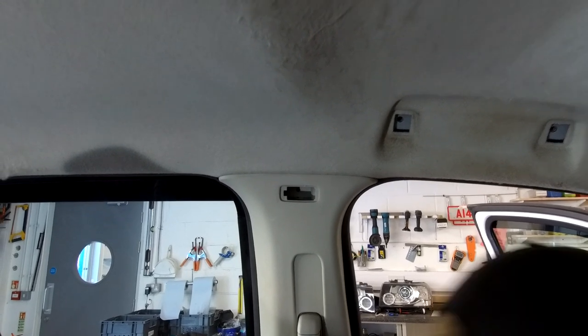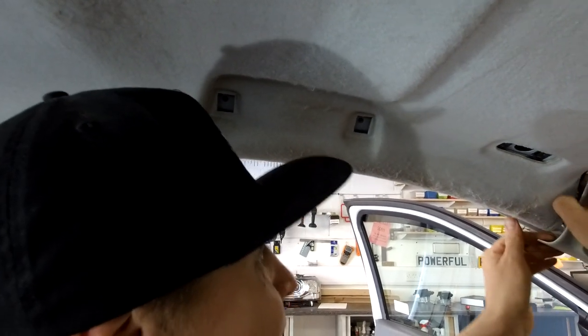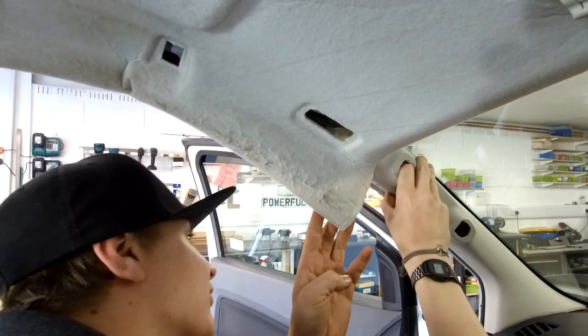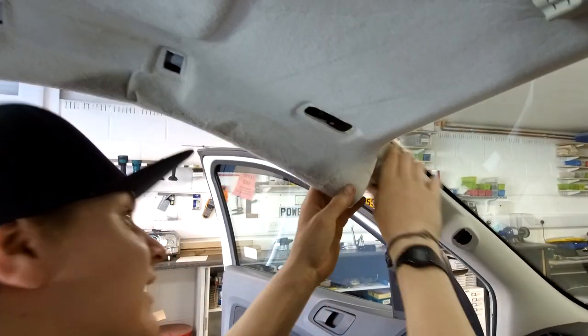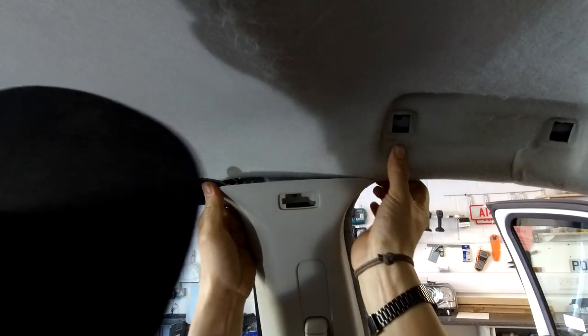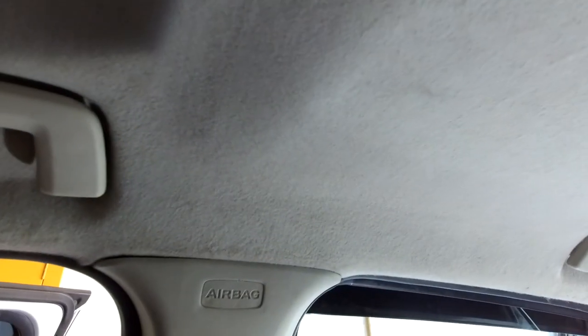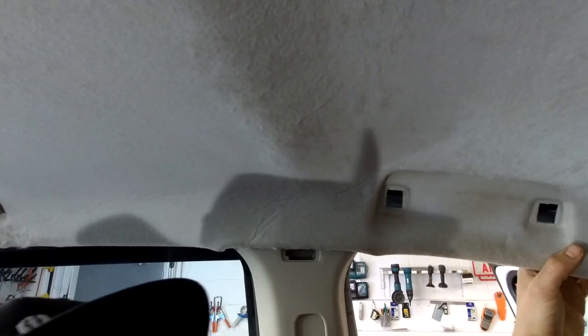Once that's loose enough, you can do this front corner. The last bit of the puzzle is the door trim — we don't need to put it down all the way, just far enough. Then just nudge and pull that around. We're creasing the headlining a little bit. Where Ian's done it on the other side you can't see any crease marks — it seems pretty forgiving. If you're worried, you'd have to take all the centre bits and the two centre lights out.